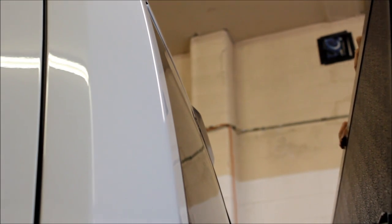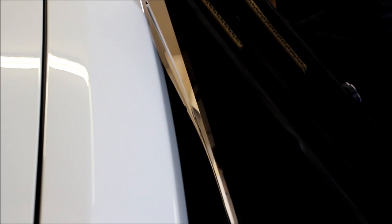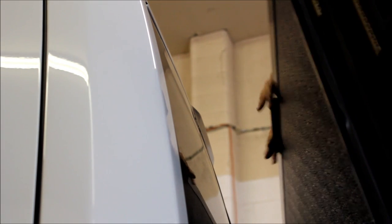You're almost done. Now we're testing the operation of the tonneau cover onto the cab. Be very careful at this point — I'm lightly putting it up against the cab to see where it actually makes contact. There's a contour on the back of this cab, so the sides don't touch at all — it's all in the middle. Remove the film, double-check where you want to place the adhesive strip. I'm going to place it on the BackFlip itself rather than the cab. I'll put two side by side, and clean the surface again because you don't know how dirty it came from the factory.